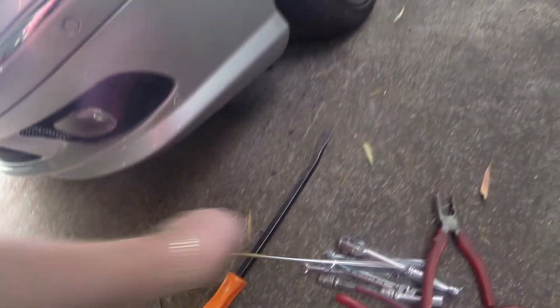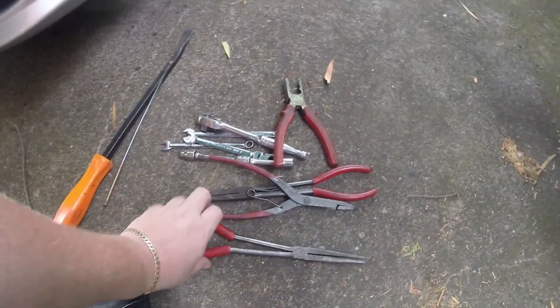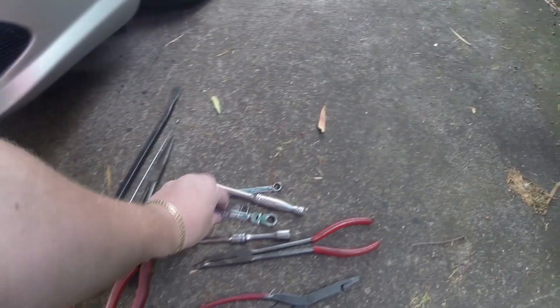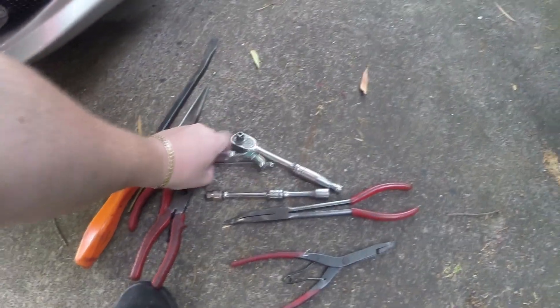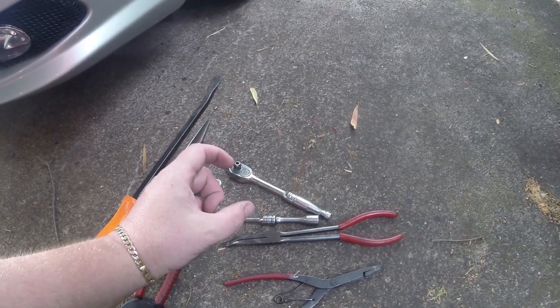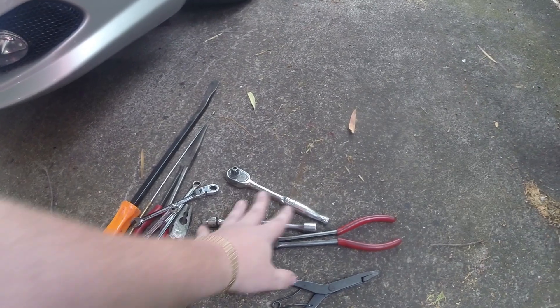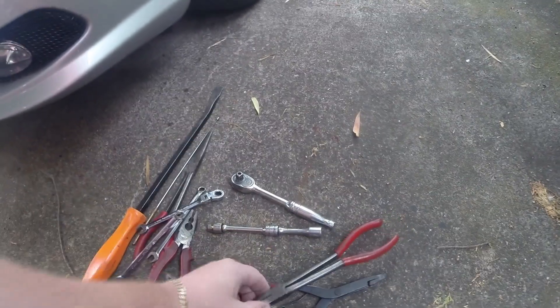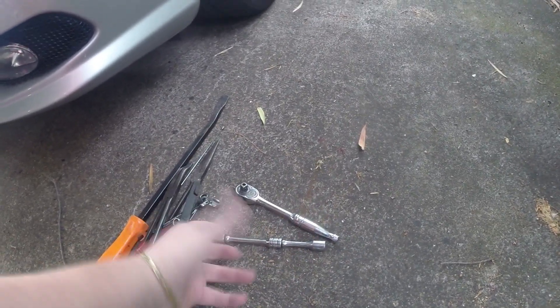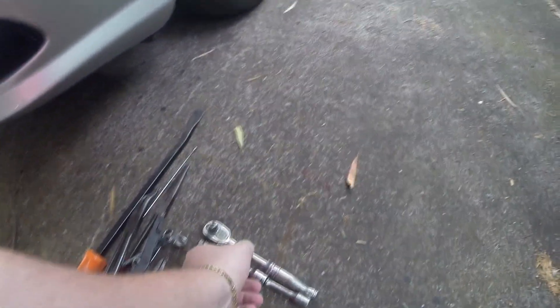Some of the tools I used are just a standard pry bar, a magnet for finding lost things, long needle nose pliers, bull nose pliers, a couple of 10mm spanners, a 9mm — that was for holding the new link and tightening up — a 10mm extension for the rear, and bent long nose pliers and circlip pliers to pop off the old links.